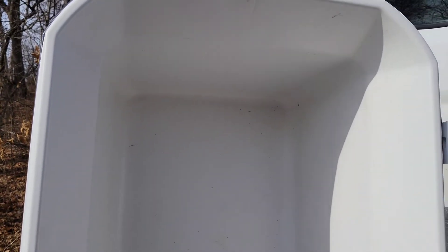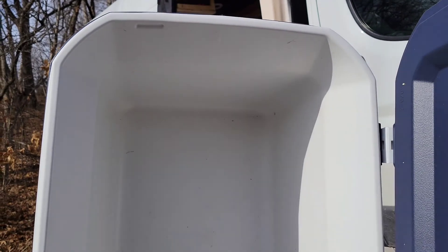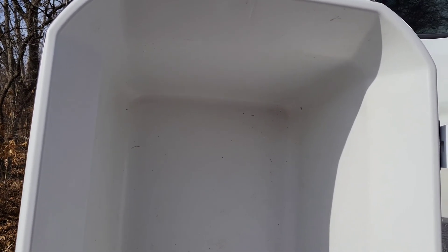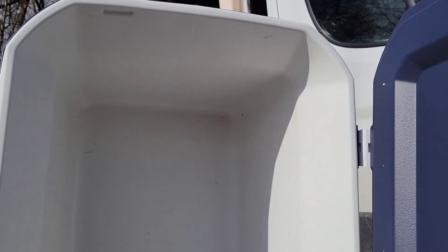At the very top, I'm going to put a big plastic tub where the ice goes in. My idea for how I want this to work — because I know cold air goes down — is that all the food will be down below and the ice will be up top in a tub. Most of the water will be collected right there in that tub, and I'll just be able to take it and pour it out. But I know there's going to be condensation and it's going to leak water as you're driving, and you don't want that on your floor all the time. Hopefully this will fix that problem and give me a nice big icebox to keep pop and stuff cold in.